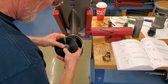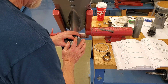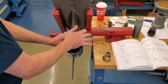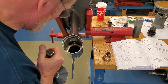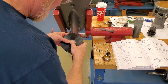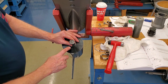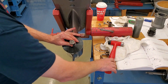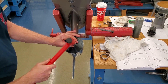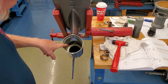Take the installation tool and slide it into the race, wiggling it around until the installer lines up nice and straight. I like to set the race installer into the case, hold it down with my finger to feel how close it is. Hold the bolt down with light finger pressure and drive the race in. Listen — you hear that tone change? Now I know the race is all the way in there with the shims behind it.